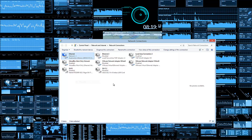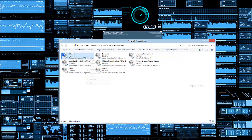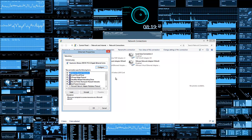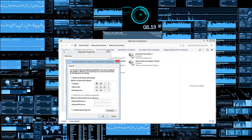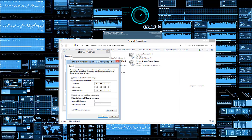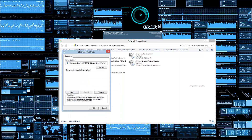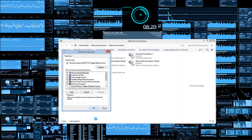Once you have it downloaded, make sure that your Wi-Fi is disabled and your Ethernet port is enabled, so that when you plug into the Ethernet your stuff can communicate. Go to network adapter Properties, go down to IPv4, and make a static IP. Make sure your subnet is the same as your regular subnet, and the default gateway needs to be 192.168.1.1. That way you've made a static IP so the router can actually see your computer.